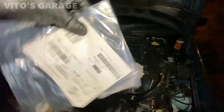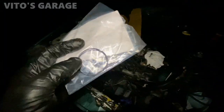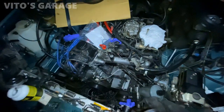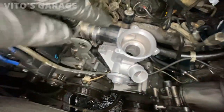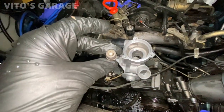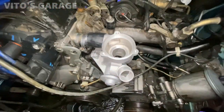Prepping the water pump for installation. The main water pump O-ring gasket goes right there — I'm installing it on the water pump first with a little bit of silicone paste. There's also a short hose that goes on here — don't forget the clamps and the new O-ring. Once you install the hose and clamps, the water pump sits and holds itself, helping you install the bolts. There's also a guide pin on the bottom so there's no way to install it the wrong way.